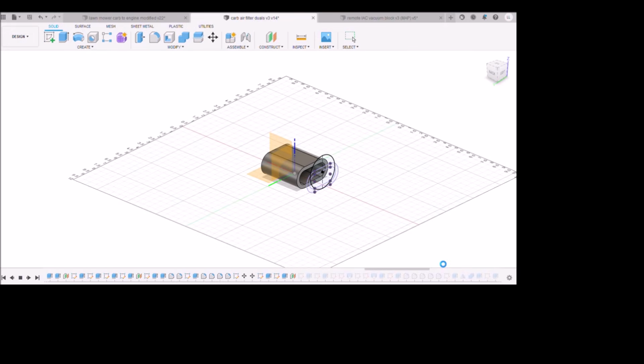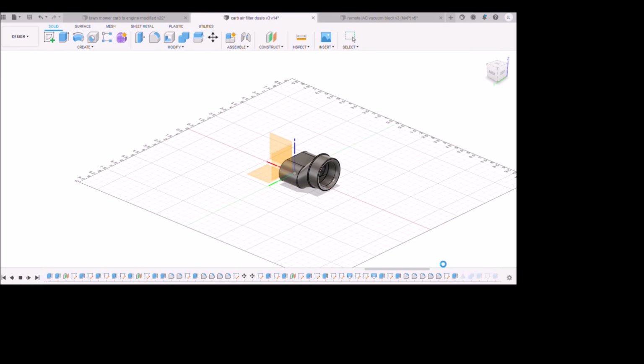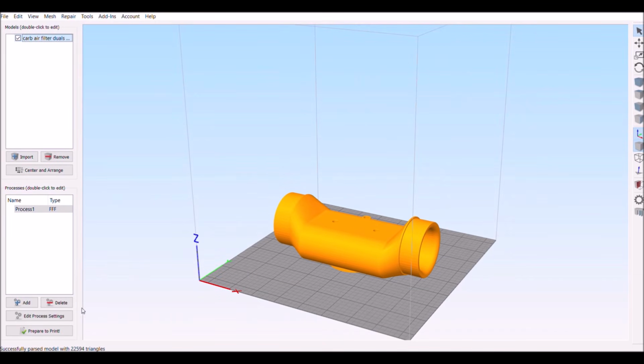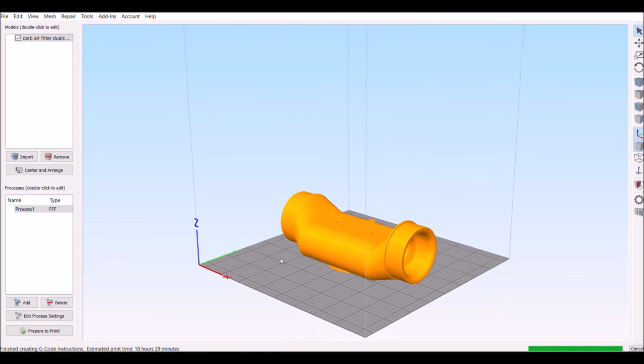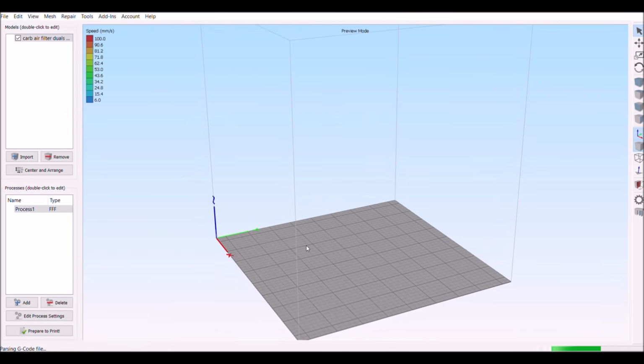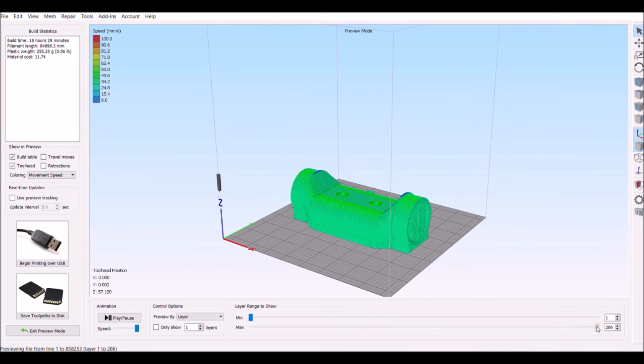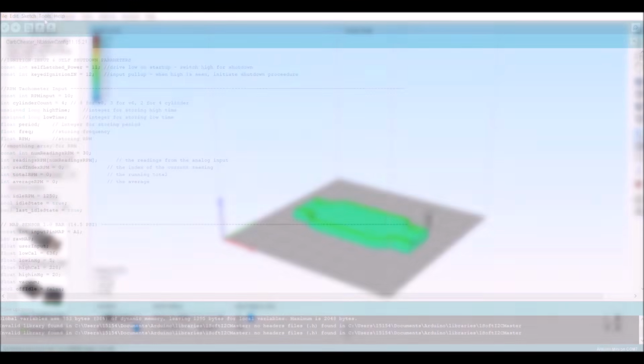Alright, so a little more 3D print work here. I made a modified adapter to basically clear that big old ugly HEI distributor that's on this Ford engine. Ford loving to put the distributor in the front kind of causes some issues, and I didn't really want to clock the carburetor at a different angle because, I don't know, just aesthetically I didn't like it that way. So I designed this bad boy up and it clears pretty good, printed out pretty good, like everything with the fine tip and layer walls. It did take a while, but it turned out pretty decent.